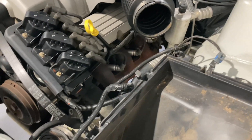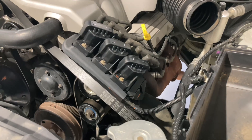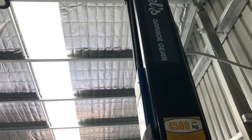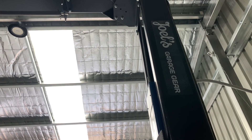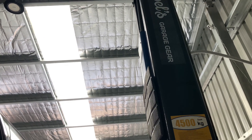We're going up with our Joel's Garage hoist. We've cracked the three bolts loose on the engine mount mounting bracket to the engine. We're going to take the four bolts out from underneath the engine mounts. If you need a hoist, just say Anthony sent you for your discount at Joel's Garage — Anthony from 4B4 Diesel, the Prado guy.